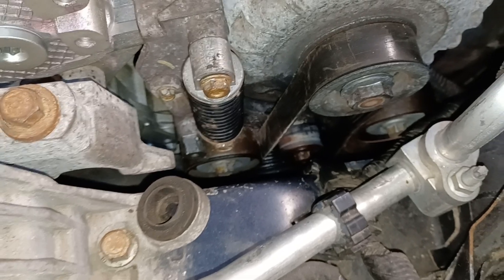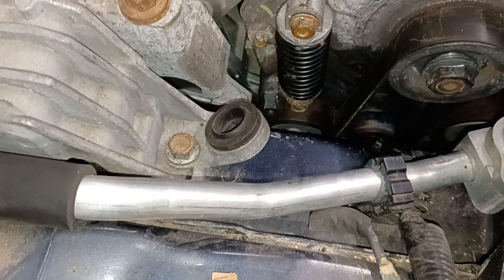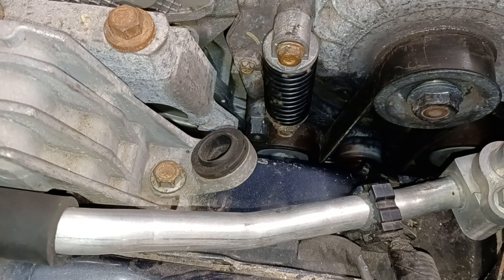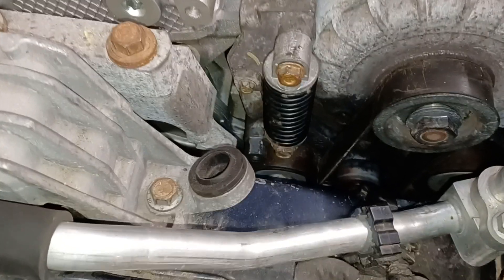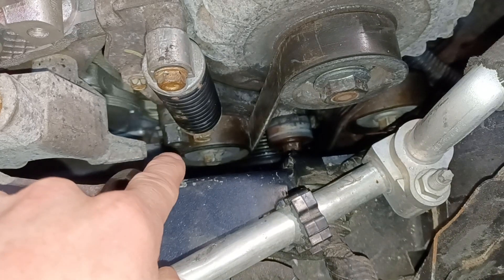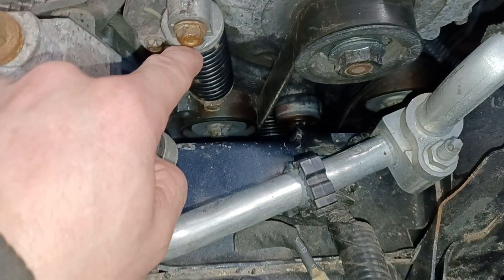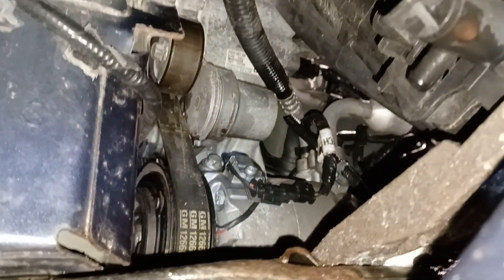You can get a wrench in there and pull it toward the front of the car from the top side — that loosens it up. What I ended up doing was prying on that big boss with the pry bar and getting the spring to compress. It doesn't seem like it's moving; you have to hold pressure for a bit because it's a hydraulic slash spring tensioner — the hydraulic causes it to move really slowly. I loosened the pivot bolt in the middle, pried up on it, got the belt off, then unbolted the spring and got that out of the way, because in order to get the tensioner bracket off you had to have that removed.